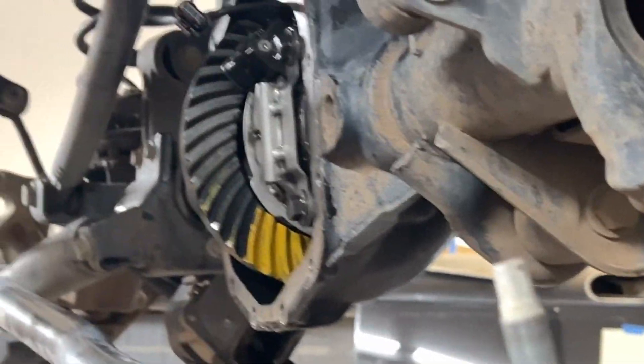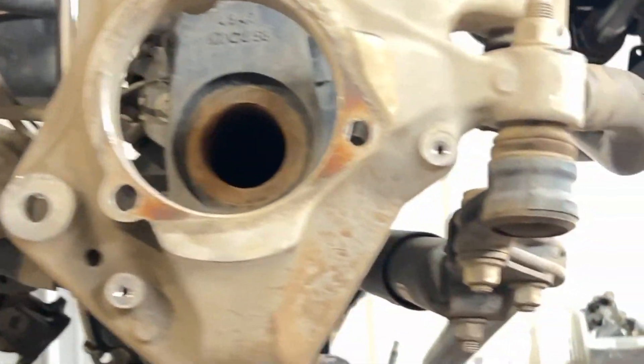We'll set this here for tomorrow to put everything back together, then we'll use our new pinion nut. I did forget to stake the pinion nut on the back — but actually I think it's just a lock washer, so never mind, I don't have to stake it. We'll finish this up tomorrow, button her all up, then take her for a drive. I have to recalibrate the computer so it knows it has 5.13 gears. Very excited to see how it drives with the 37s.